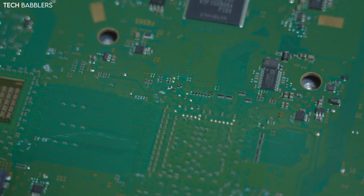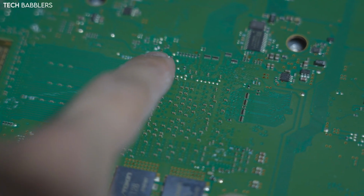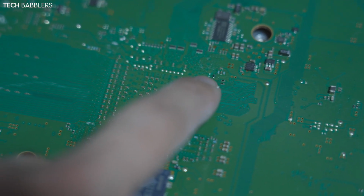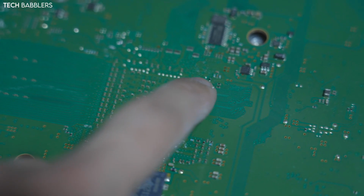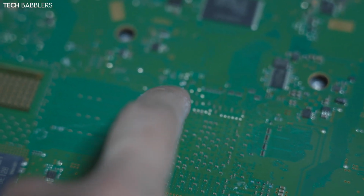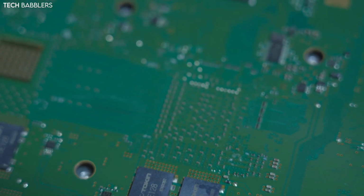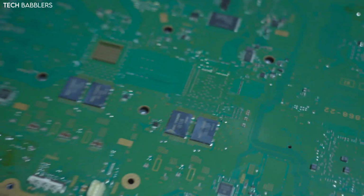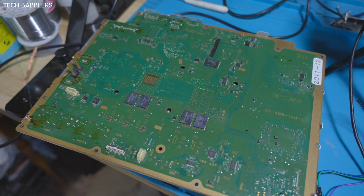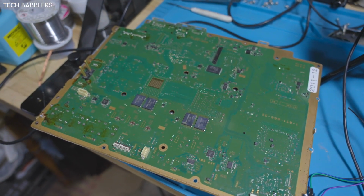It has the resistor mod done over there. So that's done. This guy's removed. That guy's removed. For anyone that does a Frankie, you know you remove this for the COK001, I guess, for it to not green light. You take the one resistor from here and put it over there for it to do its thing. That's my layman's term to explain it. Maybe it is an unofficial Frankie, but either way, syscon, error code, and see what's going on. Let's do this thing together, huh?